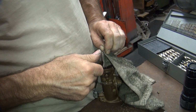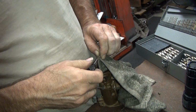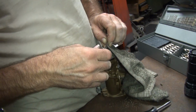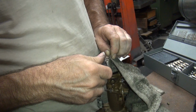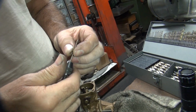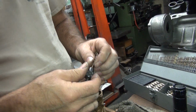So you have to get the drill to turn without cutting in, see. It's too much chip load. You're trying to cut too much in one chip. Chip load. Sounds like a special term. There it goes. That's still sharp.